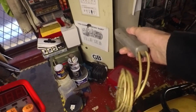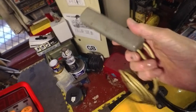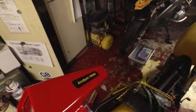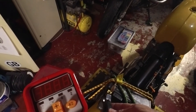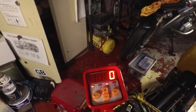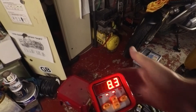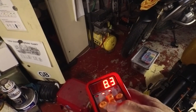This old timing light - I just couldn't get the bike to start with it; it kind of takes all the life out of the spark. So that's finally getting pensioned off after probably 40 years. I've invested in a better one - this Acu-Spark - still pretty good value for money. This one is powered by 12 volts, so you're not relying on the energy of the ignition system, and it has a display on the back so you can actually measure the advance/retard angle compared to the strobe light. In effect you can measure how far out the spark is - this should be much better.